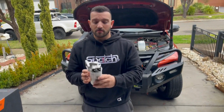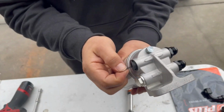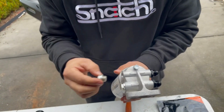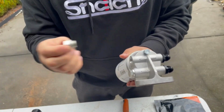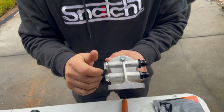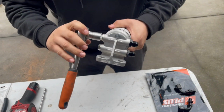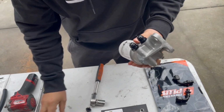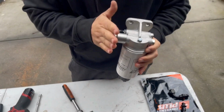And that is set up just like that. Pop it off. Now, yes, I still do have another rubber grommet in here. I do not want to leave that on there. The bolt that I've taken off from the opposite side, I'm going to be replacing that straight back onto here. It's going to make sure that when the fuel's going in and getting filtered through, nothing is coming out or seeping out through that rubber grommet. That is not necessary or required to remain there at all. Do make sure you remove it. And that's going to get a little crank over with our 17mm. Make sure they're both nice and tight. And we've got the 7/8 for the opposite side. After I lubricated, I'll tighten that up.